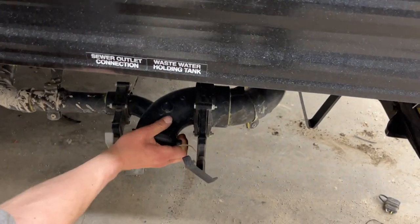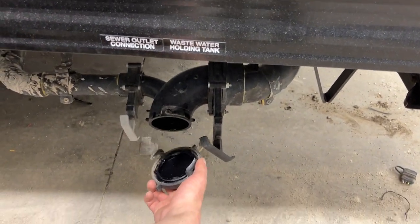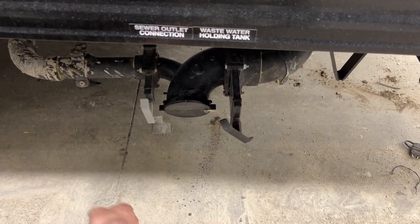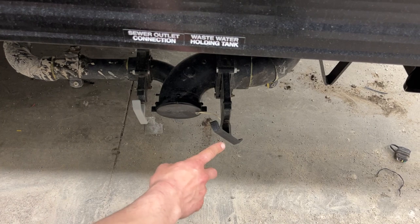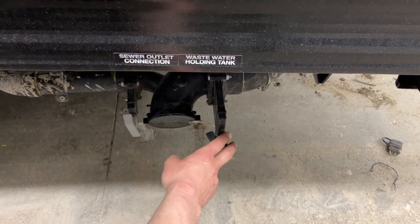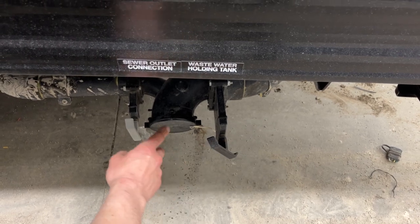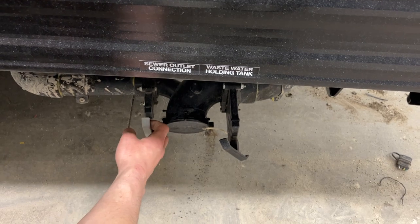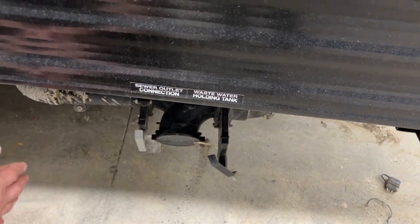A step forward from there, we've got your sewer system. That cap just pops out — it's got the same ears as your sewer hose, so it attaches the same way, pressing it in until it's locked into place. On the left you get a gray valve, on the right a black valve. The black valve controls your black tank, which is filled from your toilet — that's your dirtiest water, so dump that first. Once done, move to the gray. The gray tank is filled from your sinks and shower — typically cleaner water — so dump that last to help keep the sewer hose as clean as possible.